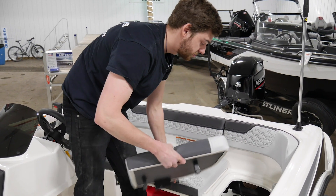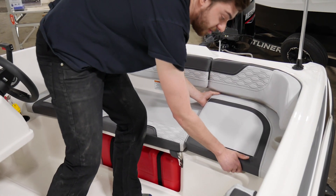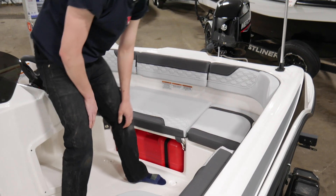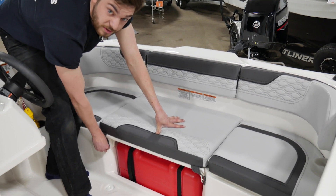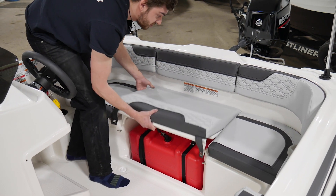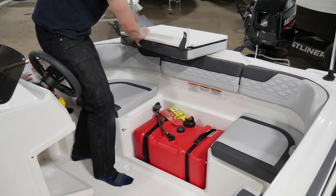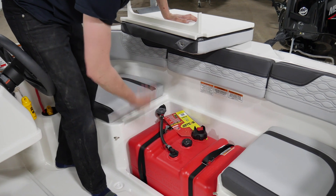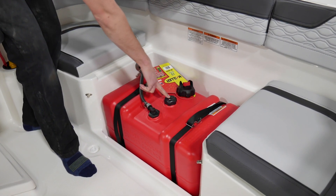And then, because of the hook, in order to put it back, you want to slide the front in towards the front, just like that. Under the middle here, with turning these a quarter turn, you can pull your straps off. And then this is where your external fuel tank is. So you have a vent here. Anytime you are running your motor, anytime there's fuel in it, you need to open your vent. There is a gas gauge here.